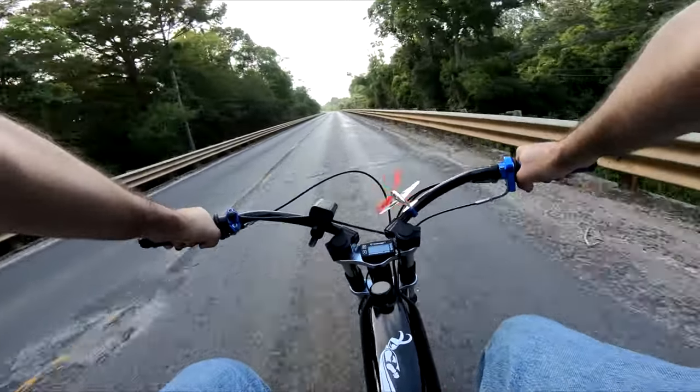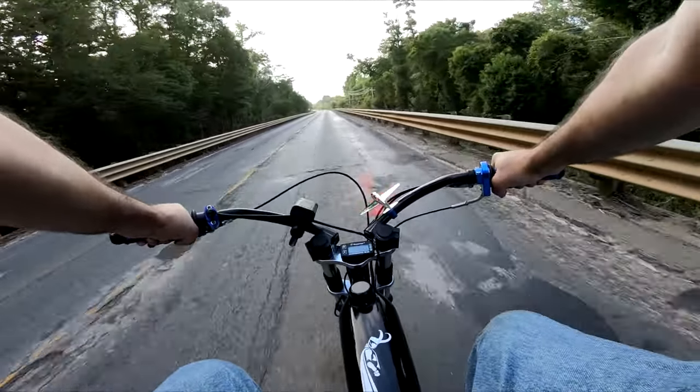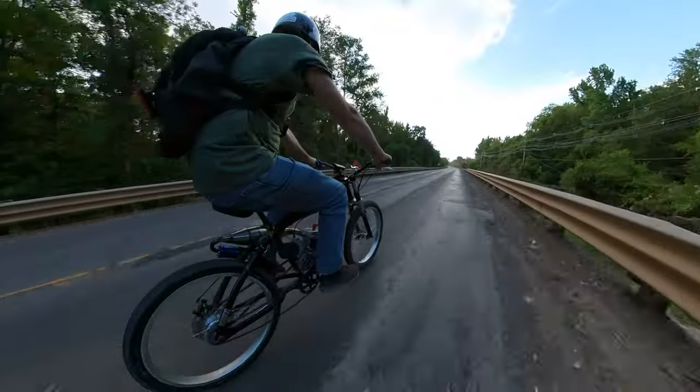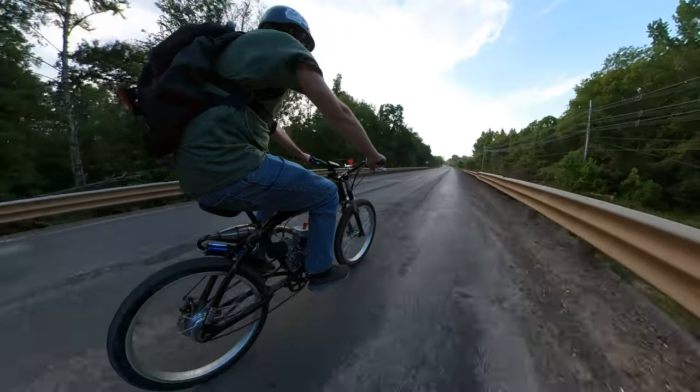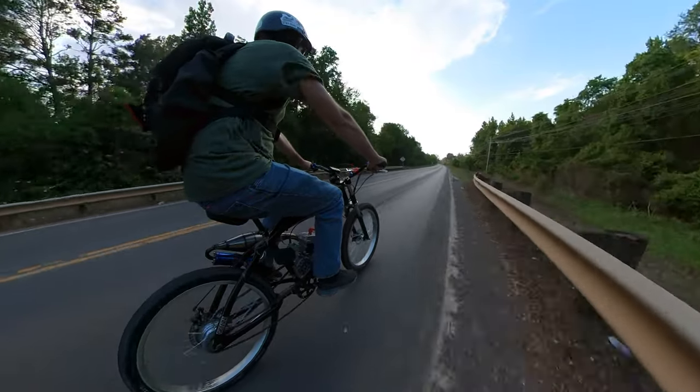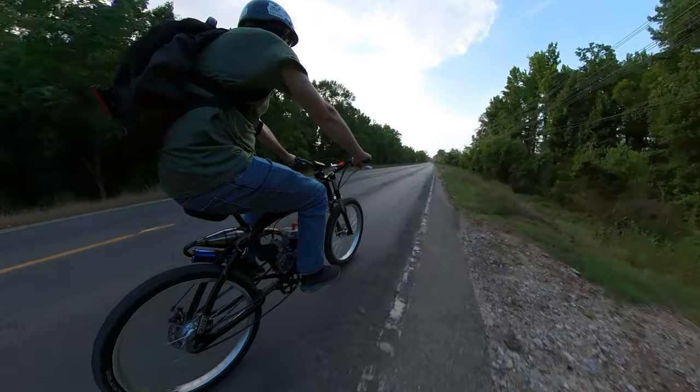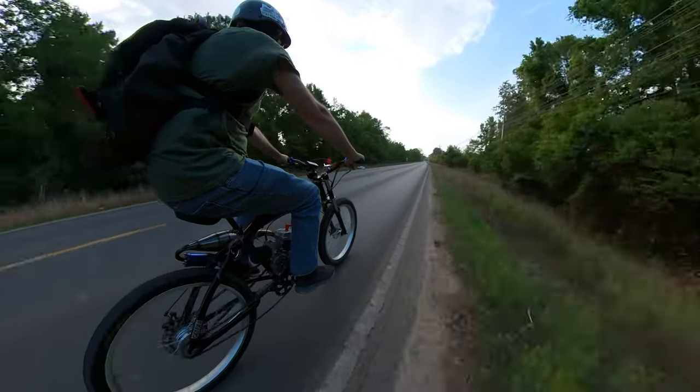After repeating the drop test with the new piston, it's not looking great. She almost just falls straight through the cylinder. At this point I had options. I could have purchased one of those aluminum cylinders, I believe they're called the Athenas, but I refuse to let my mistakes give anybody's brand a bad name, so we're going to try a fresh DLH cylinder.